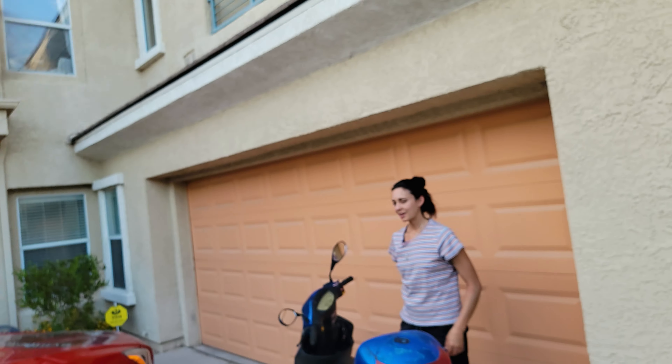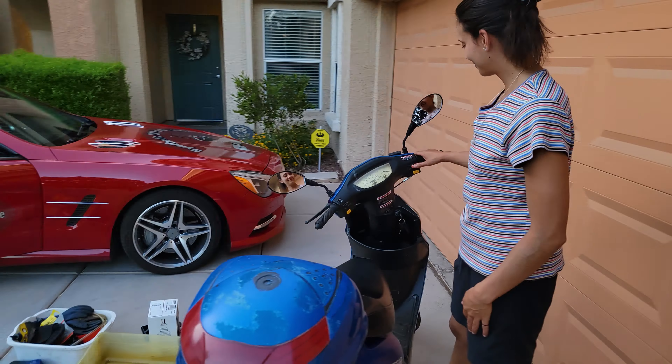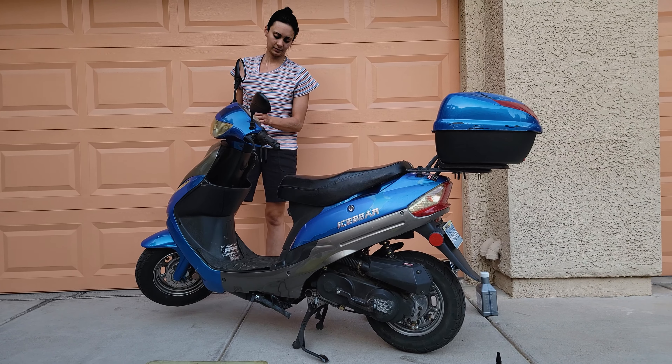It's that time to idle this scooter. This time it's not a her — what's his name? Maxwell. All right, we're giving Maxwell the whole treatment, so you can start him up. Now we just let Maxwell idle for 15 minutes. That's going to circulate the flush and it's going to help get that carbon around the rings. It loosens sticky rings and carbon buildup from running mineral oil.